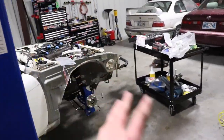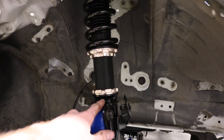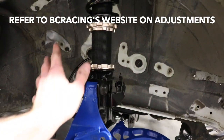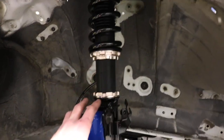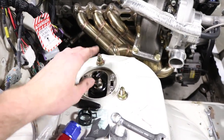I still have a lot of work to do on the car before I button everything up completely, but they do include spanner wrenches to adjust it. I'm not a suspension expert by any means, but to lower or raise your ride height you unjam this nut here, unbolt the two bolts — this is the front, the back's a little different — and unscrew or screw up this bottom section to lower your car. This right here is how stiff it is — the more compressed the spring, the tighter your ride. BC does have adjustable dampening on the top as well.